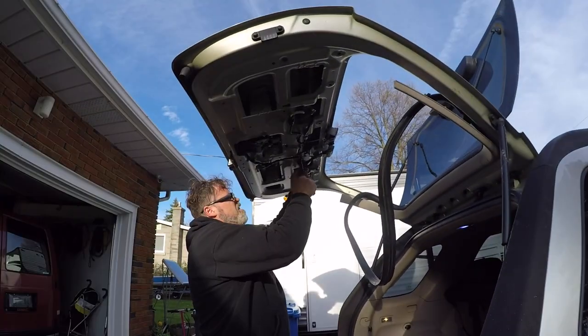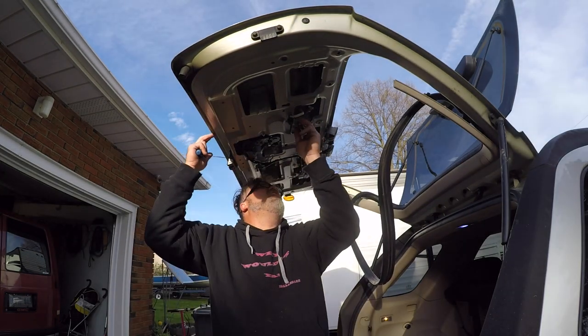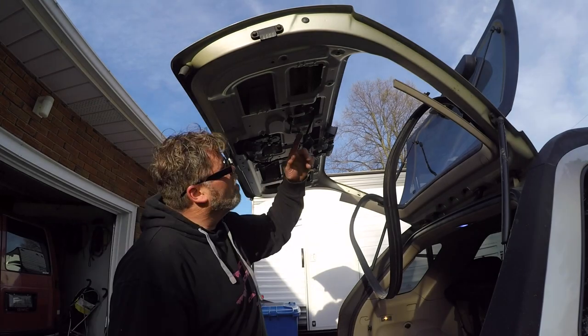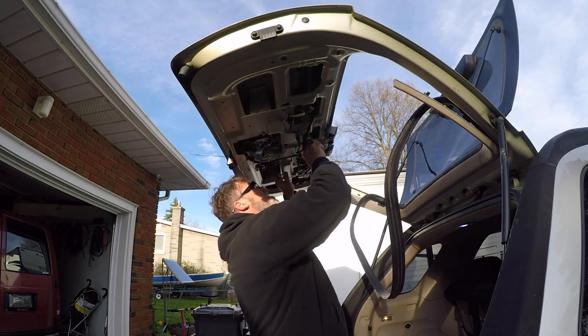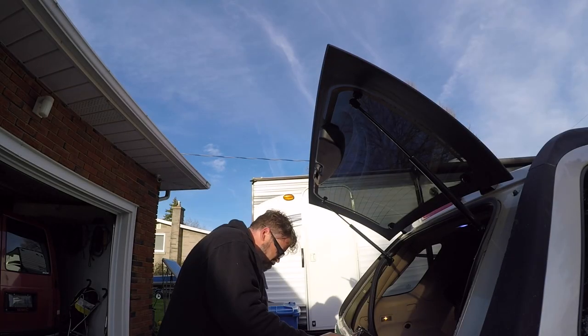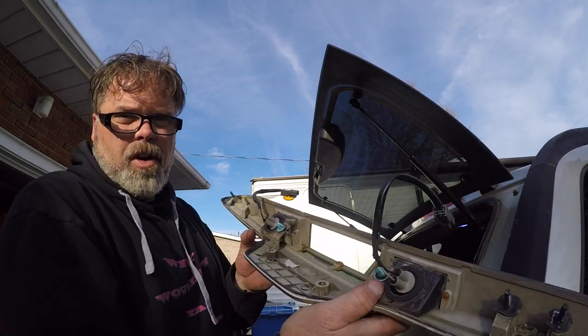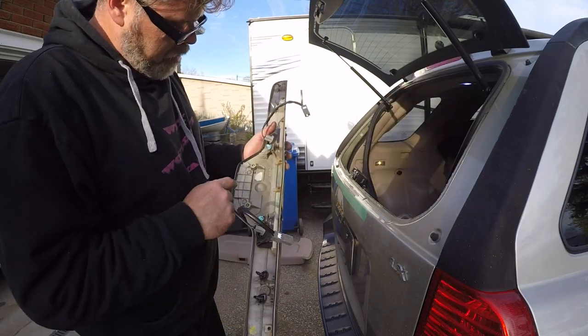On here it's got some lights — the old lights are for the license plate cover. Let me put you back so you can see what's really going on. You get to unplug these — there's one — slide that off and bob's your uncle. Those are off, and that's off. There are some clips that are a pain but we should be able to pry it off if you can get to these little clips and squeeze them. That's your best route. But 99% of the time you can't get to them. The clips are a pain but they didn't break — we got it off.